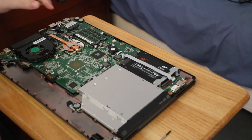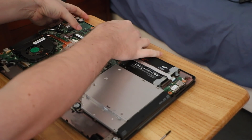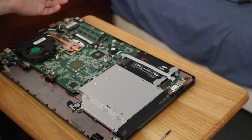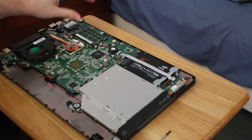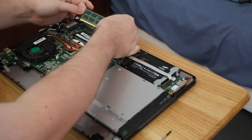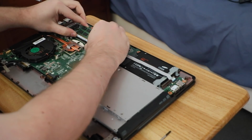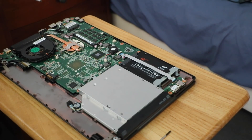So if you were upgrading RAM, you could also do that here — quite simple. You've just got two RAM chips. You just gently move the two clips and it just pops up at you. To install, you just make sure it's pushed in. If you were installing RAM, you don't want to see those gold pins. Make sure they're in and lock it in.